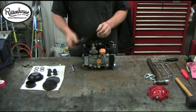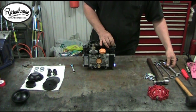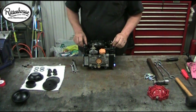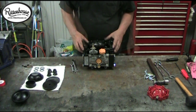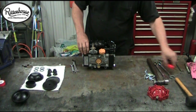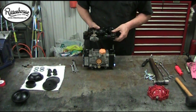Move the diaphragm and put that off to one side. Now we're going to take off the main manifold. The nuts on here are 17 millimeter, and there are only two nuts to hold the top on. Take the nuts off — sometimes you will need to pry the manifold off. You can either use a screwdriver or a small pry bar; slide underneath and lift off the manifold.